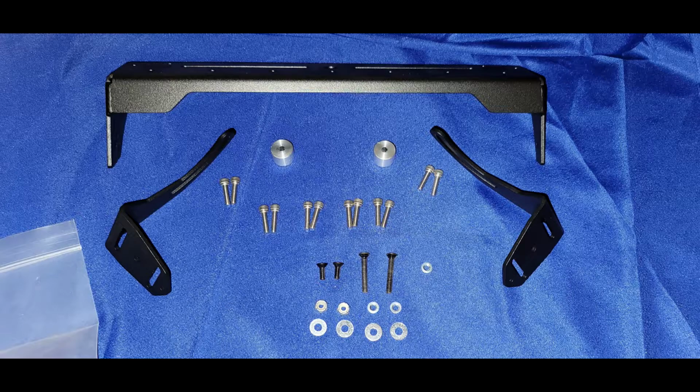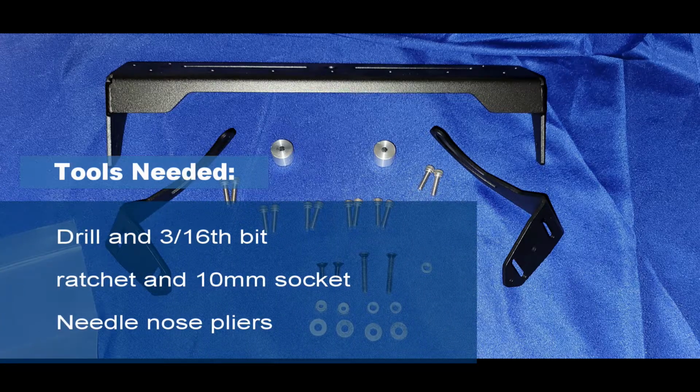As you look at this hardware kit, you can see the stainless steel screws there in the center. Those are to hold your accessories and the brackets and things. You see the two aluminum spacers. Those are for the top. And you see the screw sets at the bottom. The short black screws with the washers and the lock nuts are for the sides of the unit, and there is drilling required. The two long screws are for the top of the unit, and they go through those aluminum spacers. Those are the four holes you'll have to drill for this unit, two on the side and two on the top. So putting the bracket up and getting those marked is something you're going to want to do